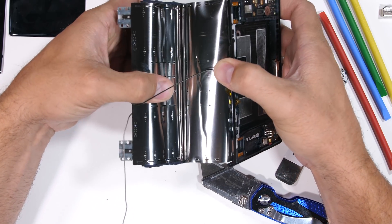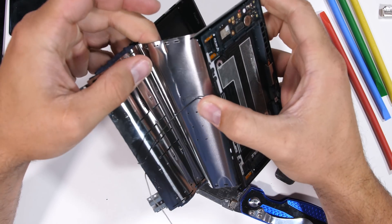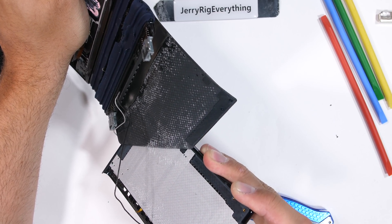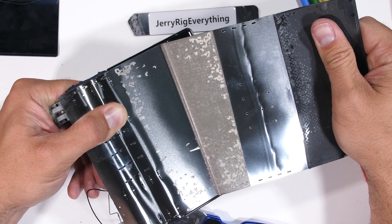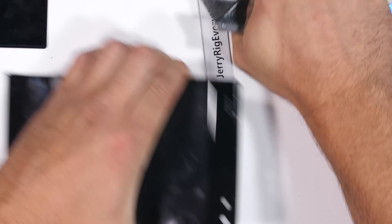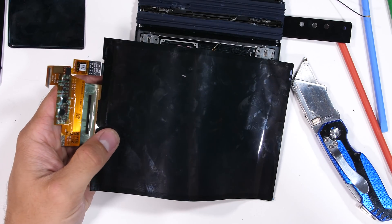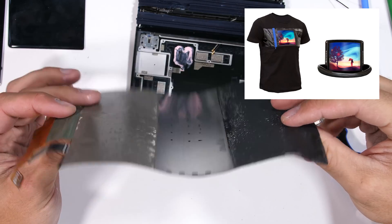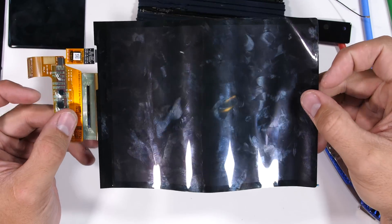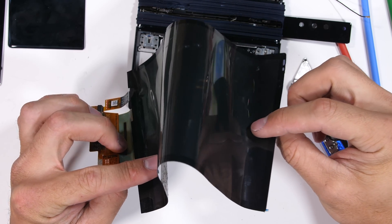With the hinge disconnected, the only thing holding the two halves together is the paper-thin flexible AMOLED display, which has a very serious amount of adhesive holding it to the foam body. I'll pull the display off the other half of the phone — it's actually kind of satisfying. The screen finally meets up with the glued-down piece of glass at the top of the phone, but with a little aggressive razor blade persuasion, the glass can be removed and the display ribbons come free. And there it is — the flexible AMOLED display. I imagine this is very similar to what Royole has attached to the t-shirts and hats they sell for $900 a piece. This technology is pretty awesome — it's a tad expensive right now, but all tech is expensive when it first comes out. Soon it'll be cheap and commonplace.